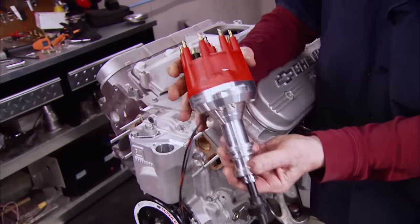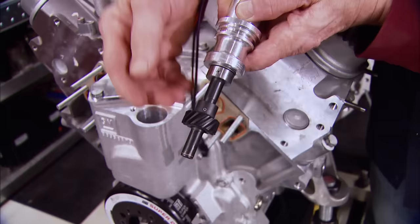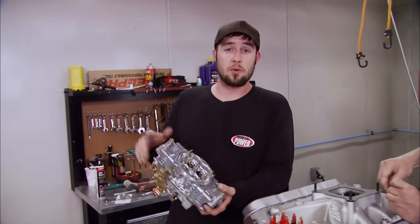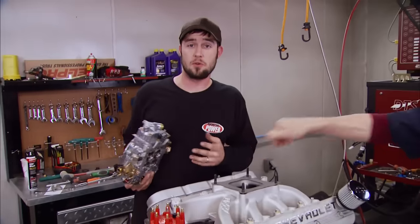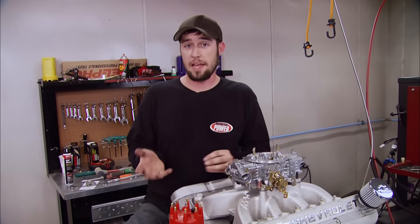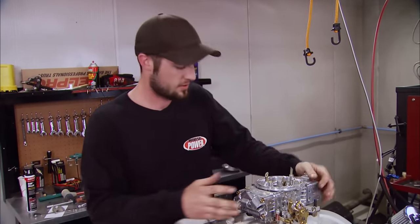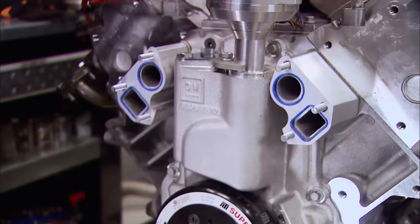You've got to come up with your own distributor for this conversion, which needs to be — believe it or not — one for a small block 302 Ford, like this one we got from MSD. We swapped out the cast gear for one of Comp's composite gears that, unlike bronze, are designed to virtually never wear out. We also had to come up with our own carb, so we went with a polished Holley 750 double pumper that will feed with premium fuel. Since our dyno already has a fuel system built in, we blocked off the mechanical fuel pump provision on the front cover. If you're installing this setup in a later-model LS-equipped vehicle, remember you'll have to come up with a fuel system since the in-tank pump puts out too much pressure for a carburetor. To clear our timing cover we're using two-and-a-half inch spacers from Wegner along with our electric Meziere pump.